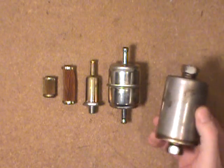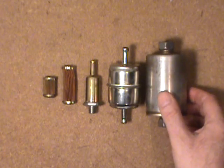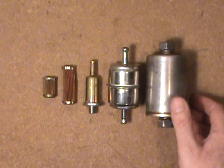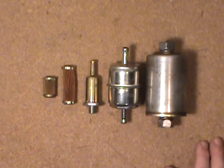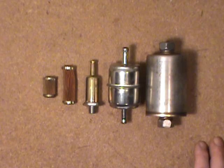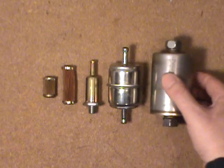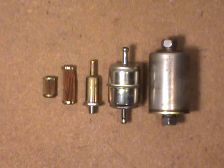As far as the location of the fuel-injected filter, this one is out of a mid-90s General Motors minivan. It has a metal strap that goes on it and a single screw that goes into the frame rail, about halfway down between the front and back tire. You get under there, work your wrenches, take the strap off, and replace it. Usually use an ice cream pail to catch the gas that leaks out.